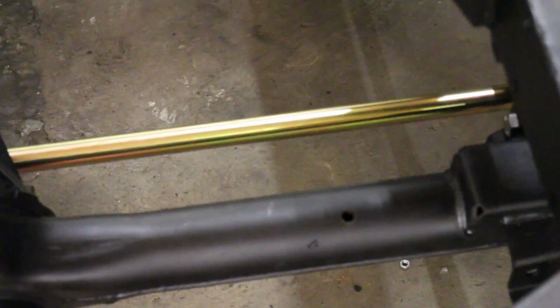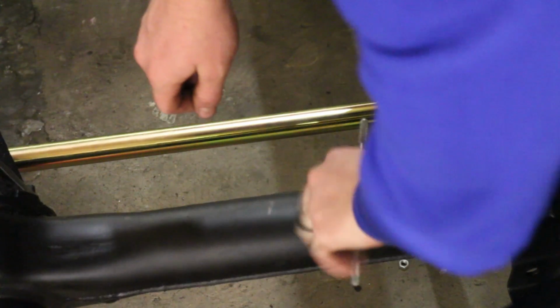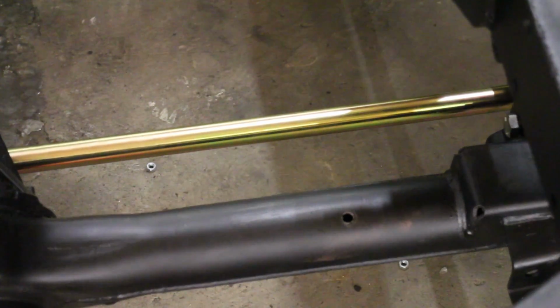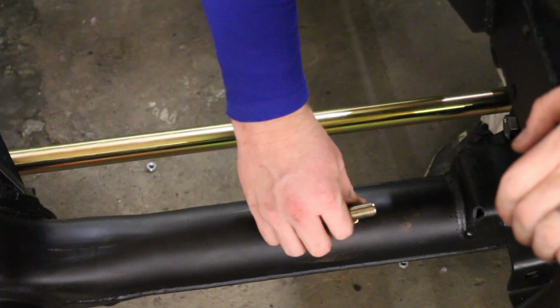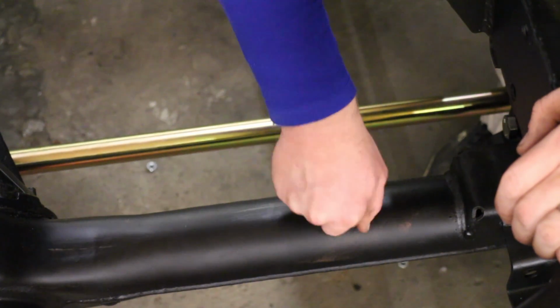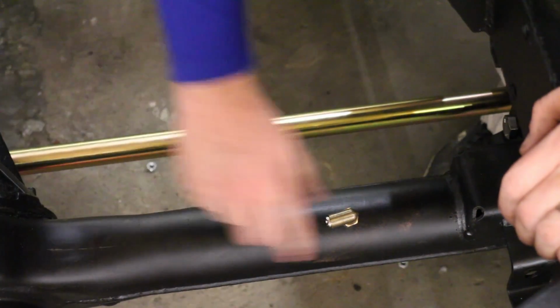Tapping it, I've dipped it in grease. Now I'm just going to tap it in square and do that. I'll wipe the hole too. It's got a nice clean cut inside there, which is very good. Then we'll fit our elbow. That should just screw in there now. Shouldn't need any PTFE on it or anything because it's got a rubber O-ring. And I want to run the pipe this way towards the diff.